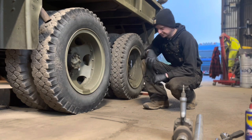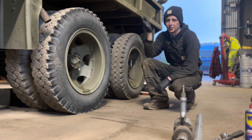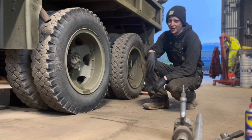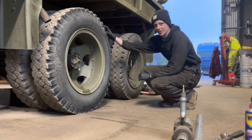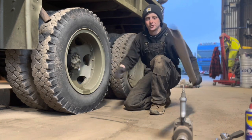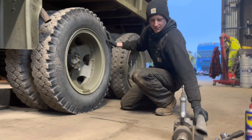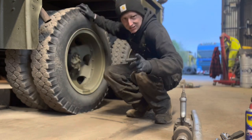Alright, so it's time to get the wheels off. This side is left hand thread because we're working on the near side, which is the driver's side. I'll have to think about that then, because it's a left hooker. So we're going to get the wheels off - left hand thread. We've got big tools and big bars because these haven't been off for a while. Let's get the wheels off then. Obviously I need to jack it up first - don't forget that.